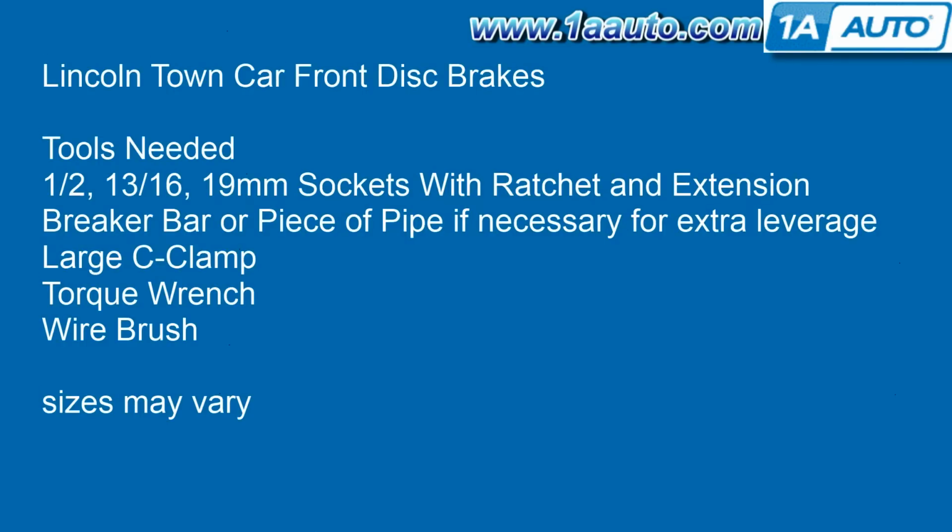Tools you'll need are a 1/2 inch, 13/16, 19mm sockets with ratchet and extension. You may want a breaker bar or a piece of pipe if you need some extra leverage on some of the larger bolts, a large C-clamp, a torque wrench, and a wire brush, and the sizes may vary per vehicle.